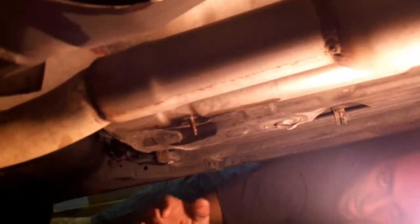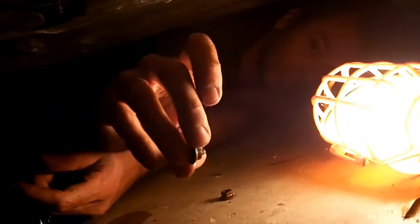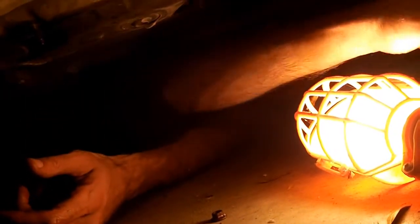Oh, that's pretty hot — from the friction. And there's the other one. Yep, sheared right off right inside of it. That's alright — another 10 millimeter nut will just fit right up. It's still got threads on there? Yeah. We're going to have to brush these threads and get all the rust off of those threads before we even think about reinstalling.